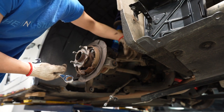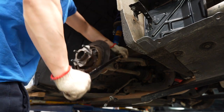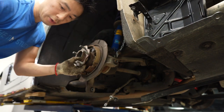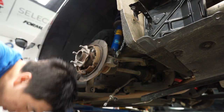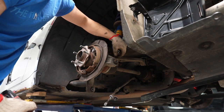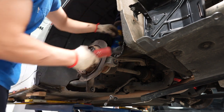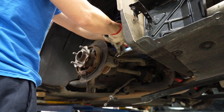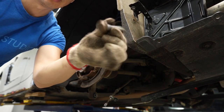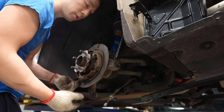Now it's a good time to start roping off the knuckle — I'm just going to brace it right there for now. What I do is connect it to the hole where the sway bar link goes, and onto the spring. You see how it just dropped — good. Now with the 17 loose, I should be able to remove the axle. Now we're going to remove the cotter pin so we can release the bolt holding the ball joint on. I moved the axle a bit so we can get access to that bolt.